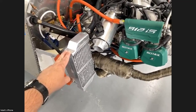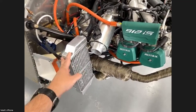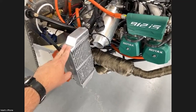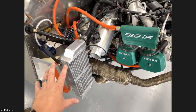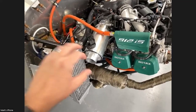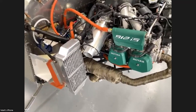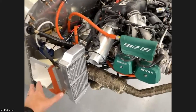We're about providing good solutions for people on a little bit more of a budget and trying to make this somewhat realistic for people to afford. Although this is definitely a more expensive engine installation option, we wanted to go with dual radiators. One of these radiators is similar in size to the area needed if you're only running one radiator. In talking to Rotax, especially with a tighter cowling installation, the IS generates a little more heat without fuel in the intake, so we wanted to make sure we had really good cooling, especially on the ground and taxiing, which tends to be the most challenging cooling situation for the IS in particular.